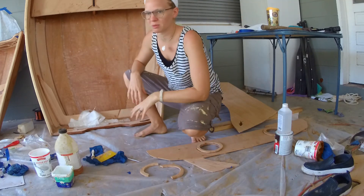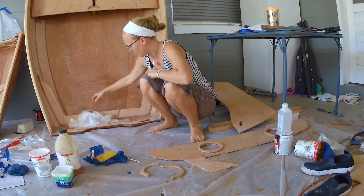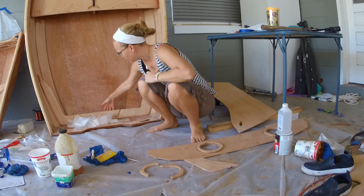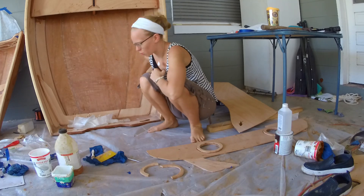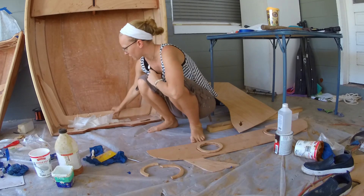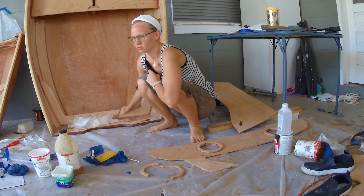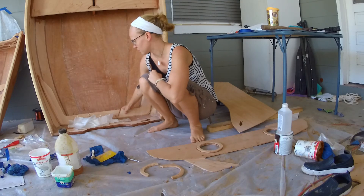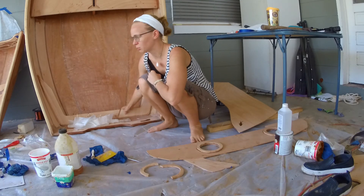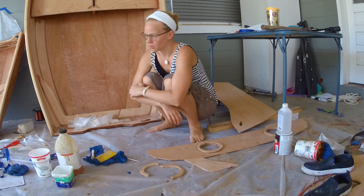Once I'm done clear coating those things, I'm going to tackle the fiberglass on the inside — the underside of the supports here. That will give it a little bit of extra strength for the back seat. It's probably overkill, but it's an excuse to practice my fiberglassing skills, and then it should be super, super strong when we put in the back seat. So here we go.